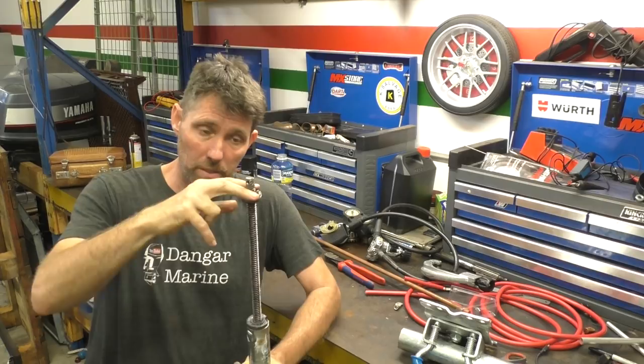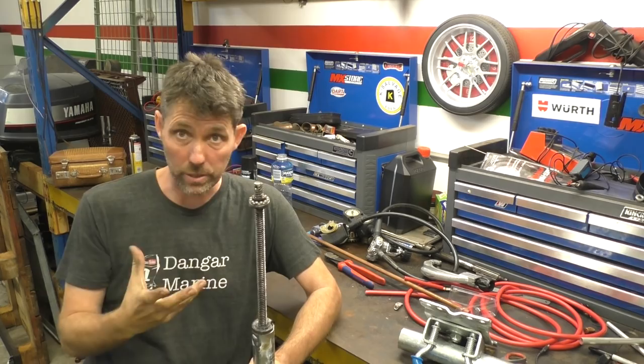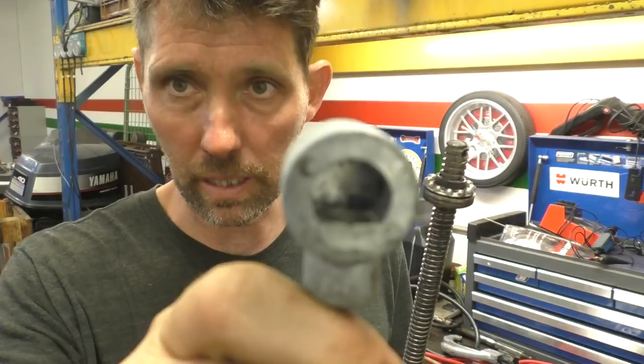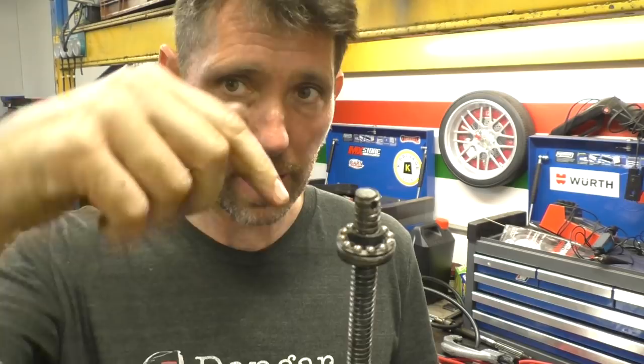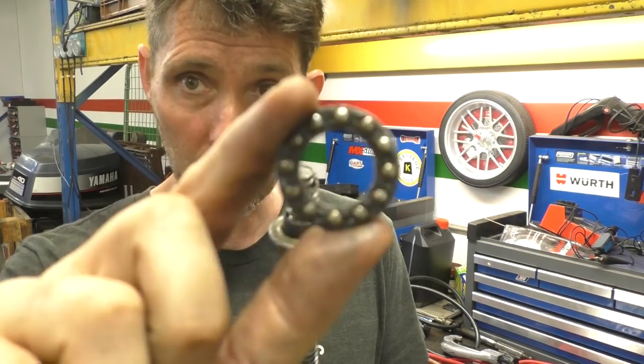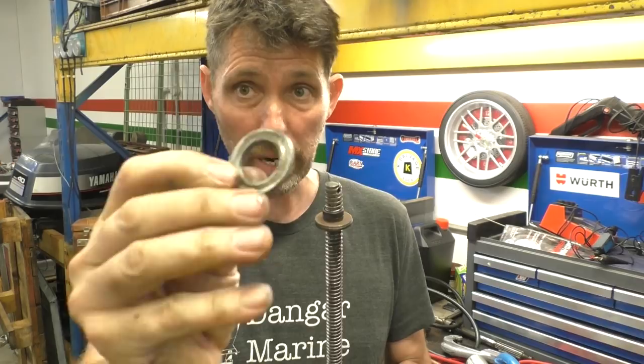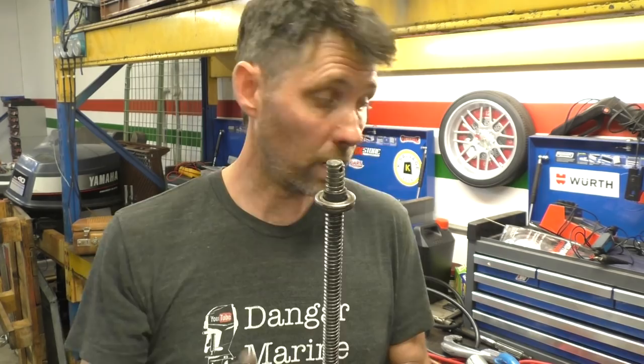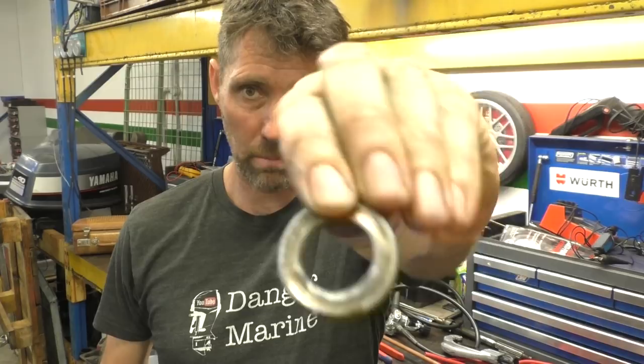What we've got at the top here is a little bearing where the weight of the trailer essentially rests on, so that it can still pivot. With the jockey wheel disassembled now, starting at the very top — you can see here there's a section where the thread's been ground off, and that's because the inside of the handle is keyed. It's that key shape that allows it to turn, and the roll pin just stops it pulling off. On top of that there's a little simple bearing. There's a washer below it — a race — it's actually got a groove in it for the ball bearings to roll in. And then a little bushing in the top. This little plate it runs on is then welded onto this shaft. There's a similar race washer that was up in the top of it, which completes the ball bearing race configuration with the bushing in the middle.